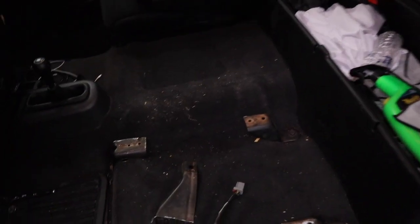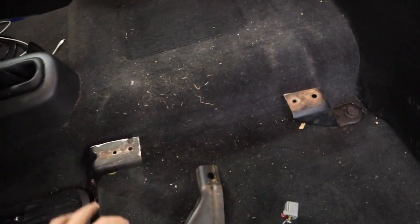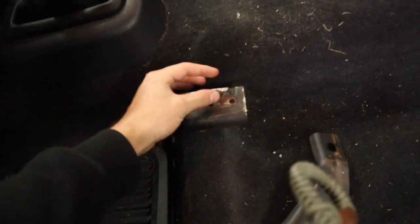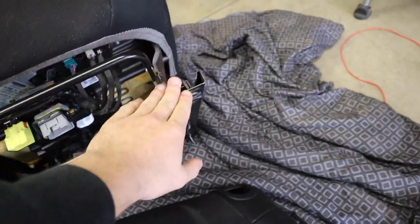We need to compensate for the width difference. The center console will probably get the brackets put back on and welded to new plates. What we settled on is going to get some metal and basically make a box out of it for strength. Then we'll bolt the seat through it. The metal is going to overhang a little and extend to the tunnel wall - that's as far over as we need to go. We want to use our original factory mounts so we don't have holes all over the place.